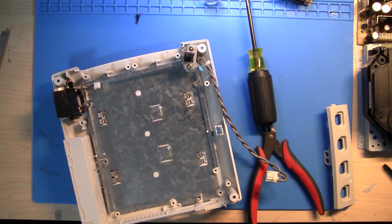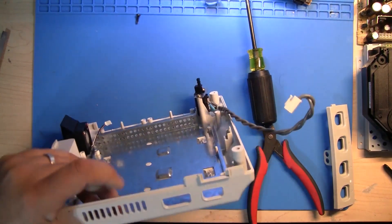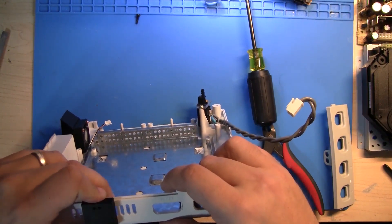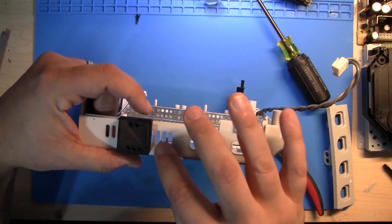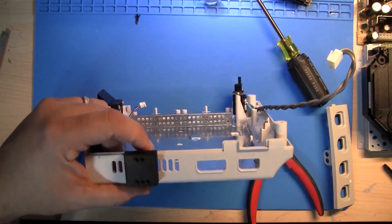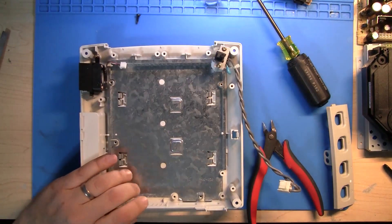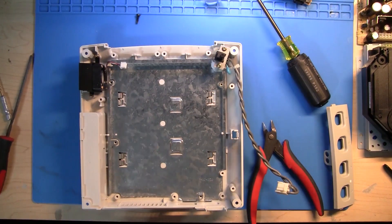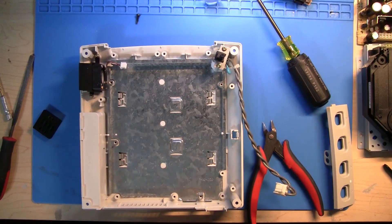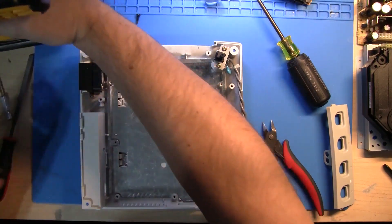Next, we are going to use our drill block, which is right here. This is where I recommend going slow. If you want to count the holes, you're going to be showing three and a half — you're always going to be showing three and a half little holes on this side, and that's where the drill block needs to go. For the main side, to drill this out, we are going to be using a 3/32" drill bit. You probably could use a smaller one, but I wouldn't recommend it.